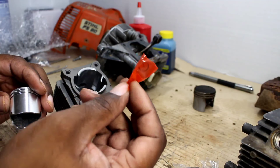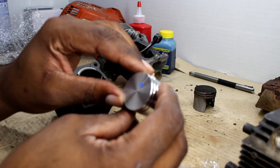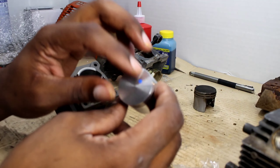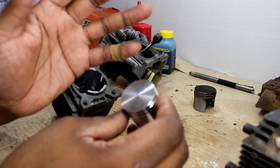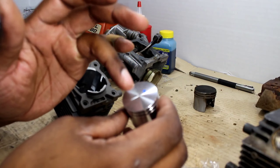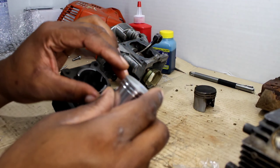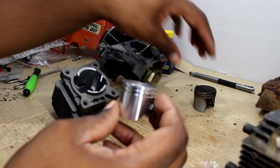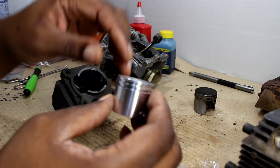These circlips are a little different than the factory ones but they're a lot better for install. Here's our piston and it doesn't have an arrow pointing to the exhaust — I don't know why a lot of these don't have it. They got a blue dot right here, and it's technically pointing toward the exhaust side, but I've had them where the blue dot has been in the center and wasn't right. I would just go by looking at the old piston — that's the best way to do it. You can see how they match up and everything's in the same place, so that's the safer bet.